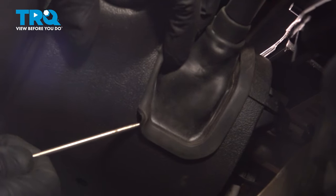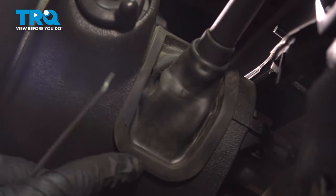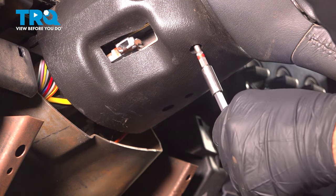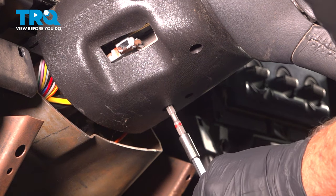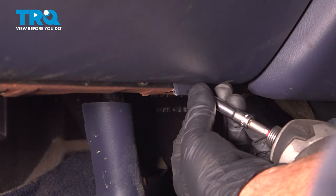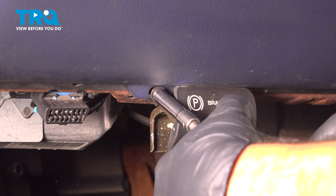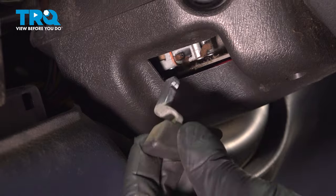Where the shifter boot is, pull this — you can use a pick or do it by hand. Make sure it's in the right location; it's just like a grommet, all the way around. And the screws underneath — get those lined up and snug those down. Put that screw in and snug it down. Take the panel, line it up, lock it down. Take the column adjuster lever, line that up, and push it down.